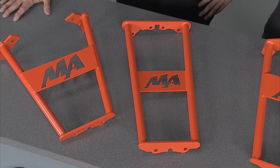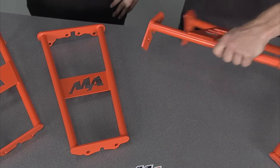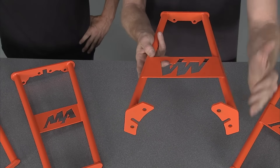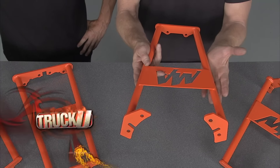The problem is all the weight is hanging off the back of the trans with no support for it. Merchant Automotive has this bracing that goes into place — this support actually goes up to the rear of the trans, brings all the load off the back, and everything is nice and supported, eliminating that problem.